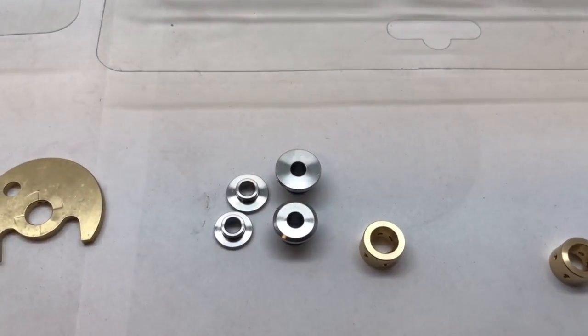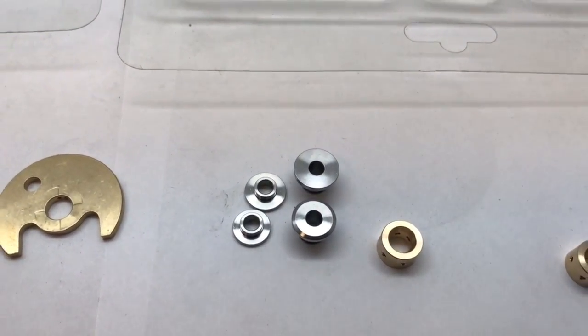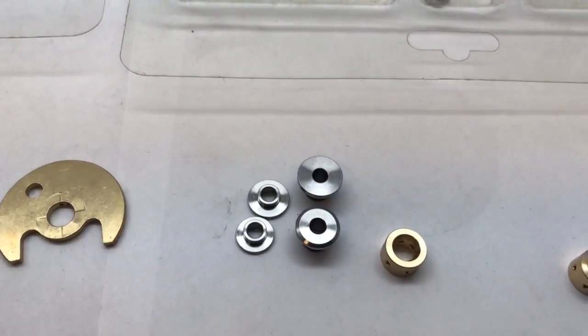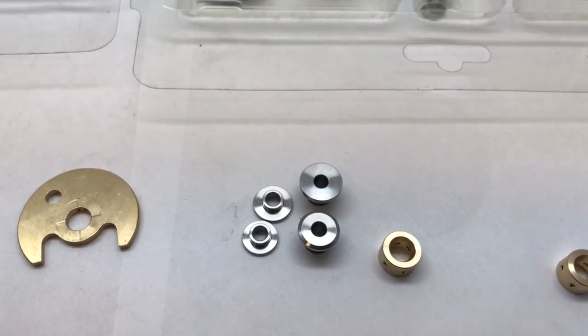The difference in the collars for the upgraded and non-upgraded: the non-upgraded is on the bottom, the upgraded is on the top. The upgraded collars have a 14 millimeter surface area placed against the thrust bearing for increased durability.